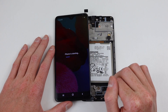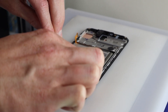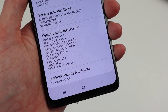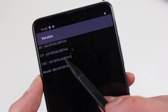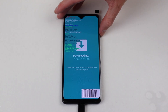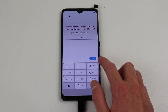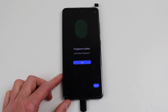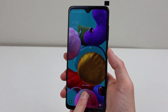I rigged up the phone with the aftermarket screen and you can see just how terrible it looks, but the fingerprint reader still doesn't work. I decided to remove the battery and install it in the aftermarket screen just to make things a bit easier. You can see I'm on the September security patch update, which apparently introduced these issues. When it comes to downgrades, you need to make sure that the binary version is the same as the version you're trying to downgrade to — for example, you can't downgrade from binary version 4 to binary version 3. Given this limitation, only one of my phones is capable of installing this previous version. After downgrading, with a replacement display, you can see it's working perfectly and successfully registers my finger. Even with this very low quality screen, it works perfectly fine on the March security update.